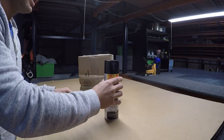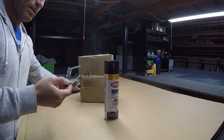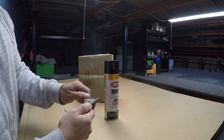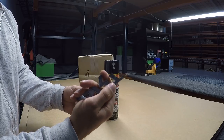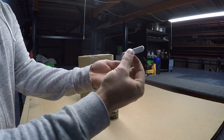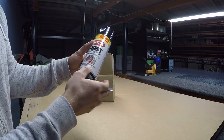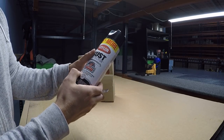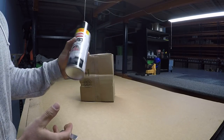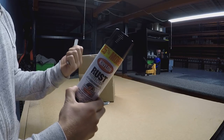Just so we don't have any downtime waiting before I disassemble that grille, I'm gonna go ahead and paint the bracketry for the SRT emblem. This is kind of how it comes — it basically just screws out of the back of the emblem itself, and you're left with all this hardware. I'm just gonna go ahead and blast all these with some paint. I've got some Krylon super fast — it dries in eight minutes and it's direct to metal, so you don't have to prime it. Let's blast all this hardware so it's all black and matched.